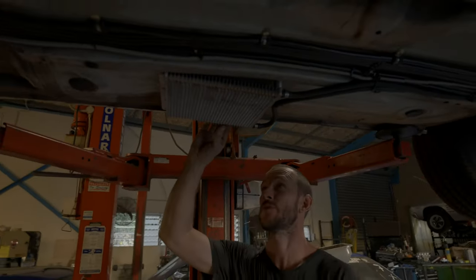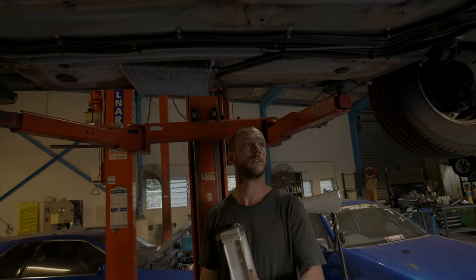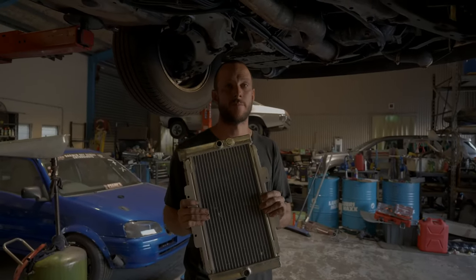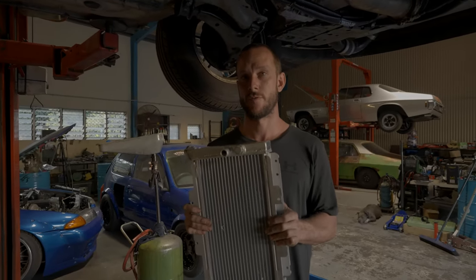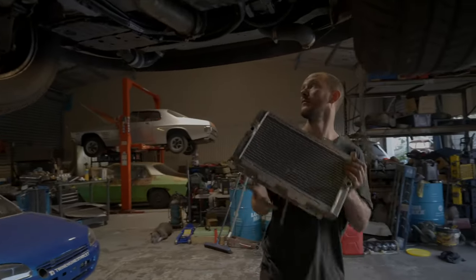The aluminium pipes under the car — just the wind brushing past should help improve it a little bit. The transmission cooler is already working really well; we don't see transmission temperatures any higher than 60 degrees. But even when we go up a mountain and we fix the water temperature, what if it's the oil temperature that's making it go through the roof? Then we'd have to put an oil cooler in somewhere. We'll worry about that when the time comes.